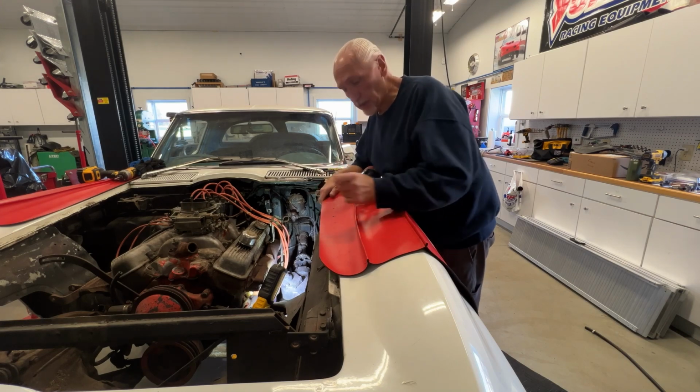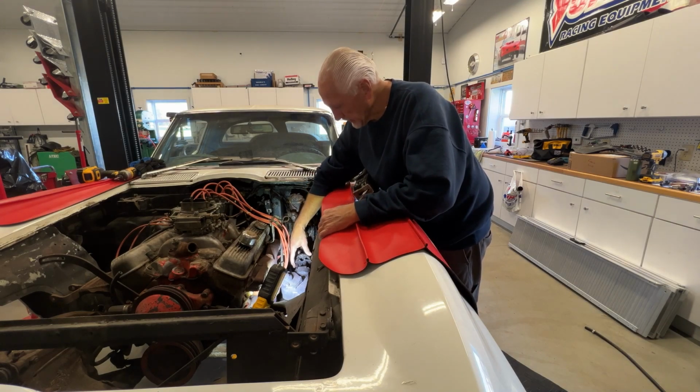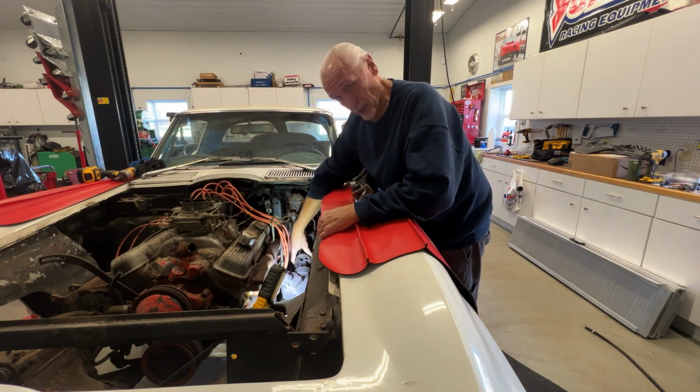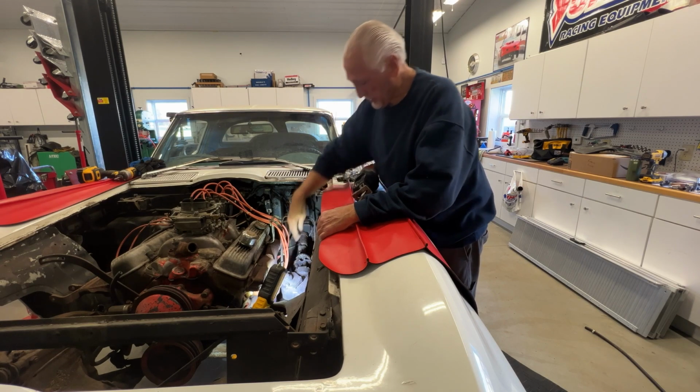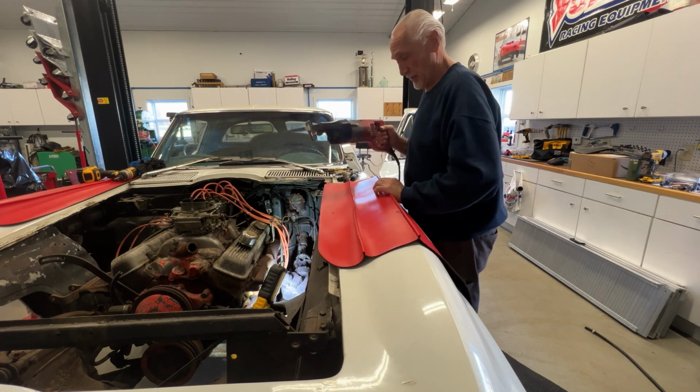Well, what I've been trying to do here is remove the rag joint. I can tell you these bolts are all rusted. And when you try to turn the bolt, your steering column's twisting too, so it makes it more difficult. I am not going to reuse this rag joint, so I'm going to use the trusty old Sawzall.